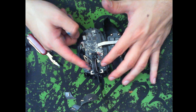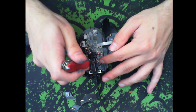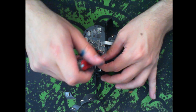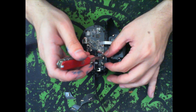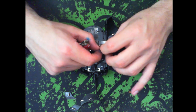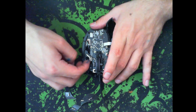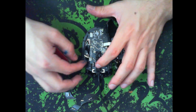The part we care about is right here. First thing we need to do is unscrew this — this part is keeping the wheel in place. That other component is just the LEDs that light up the wheel, so it's not that critical. If you don't want your scroll wheel to light up, you could completely remove that little circuit board. Now we'll disconnect the cable connector the same way we did the other one: grab it from the white area, pull gently, and it comes out on its own.